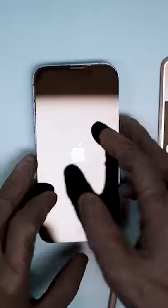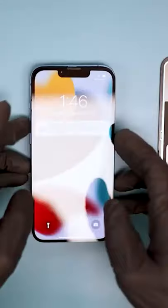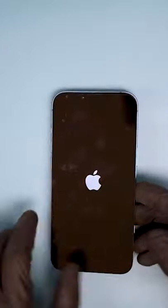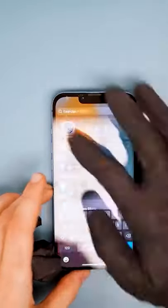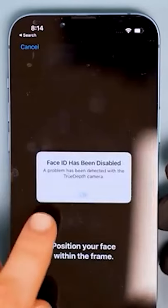Replacing the screen on the iPhone 13 series through third-party repair will result in the loss of Face ID, as Apple has paired the screen to the Face ID module. In our first trial to solve this problem, we removed the Face ID activation error by swapping the IC, but also triggered a failsafe which damaged the Face ID module, despite it being untouched throughout the entire process.